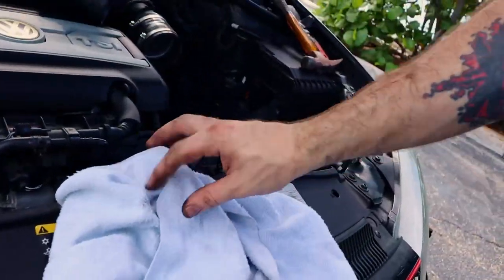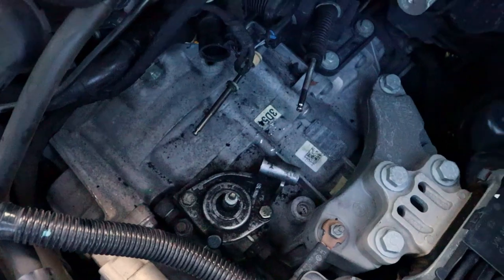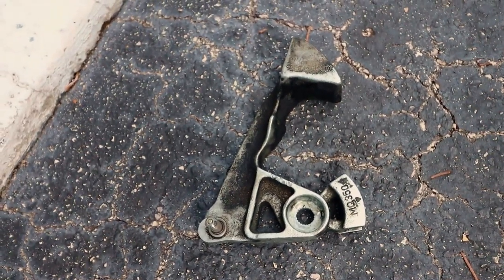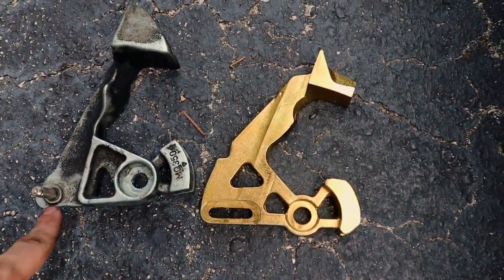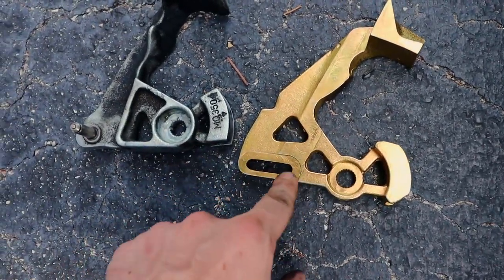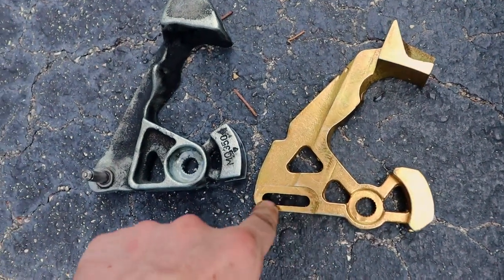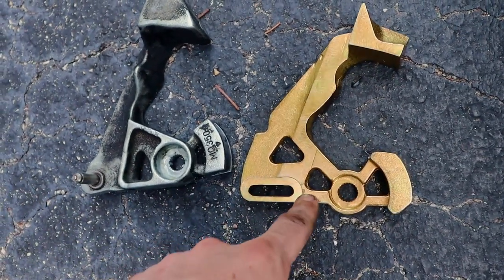Another quick update — my hands are filthy, so is the towel I'm using to wipe my face and hands. Progress has been made though — it's gone, took it out. Check it out guys: here's the old shifter, here's the new one. The immediate difference is this one is fixed, but this is variable, and all the way down here is a 40% decrease in shift length, and over here is just factory. I'm going to be putting it all the way over to the 40% side.